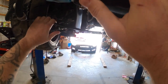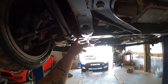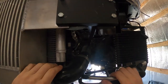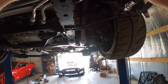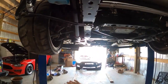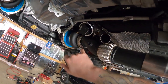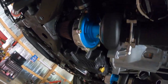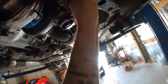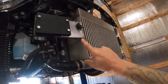What we're going to do is cut up some radiator hose anywhere we think there might be charge pipe to metal contact with the body, to get rid of any false knock we might run into. Very tight fit, but what's cool is we're almost flush here — it is beautifully tucked. Turbo Smart Hyper Gate 45s — same ones I have on mine — with the 64/67s. They look freaking awesome under the car. It's a shame they're bottom-mounted because you'll never see them unless you jack up the car.